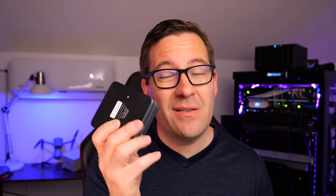This micro PC sports an Intel N100 processor. One of the things that really appeals about this processor and many others in the Alder Lake family is the power efficiency. This processor has a TDP value of 6 watts, and with turbo enabled it can burst up to 25 watts. It has 12 gigs of memory — honestly there are some better deals out there where you can get 16 gigs of memory paired with the N100 for roughly the same price, maybe even cheaper. However, those are a bit larger than this form factor. I can literally fit this in the palm of my hand, so this form factor is really, really tiny when thinking about running virtual machines.